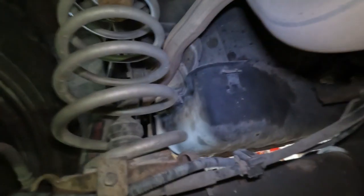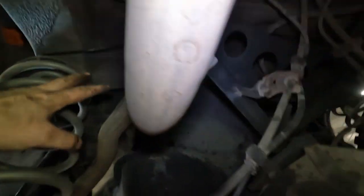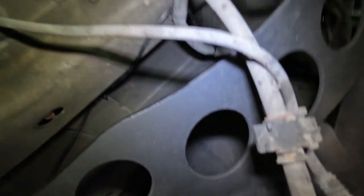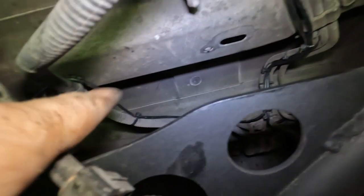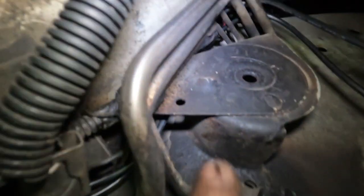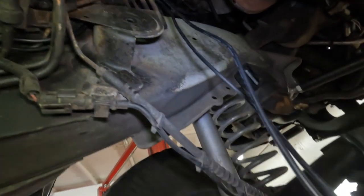I got a lot of the wiring done - comes down, comes across. I've got a good enough gap here; I do have heat shields but I think I'm just going to send it and see how it does. I got a little zip tie there, found a little hole I could go through so I didn't have to drill anymore. It comes and attaches to the wiring harness in the back, runs across to the fuel and brake lines, and basically we route all the way along those lines, fish them up behind this, and then go up under the hood.